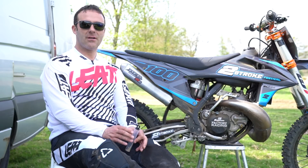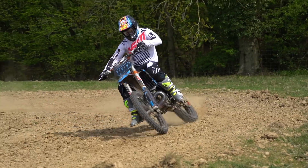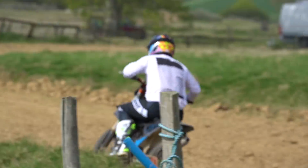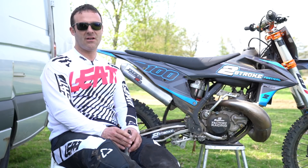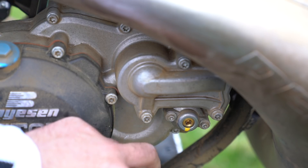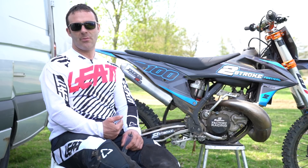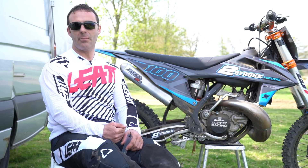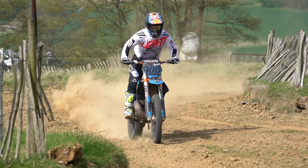For me, I really do like, on the setup that I'm running and the bike that I've got behind me on a 250, I prefer the standard spring, and I just wind it in just a little bit. Normally I'm roughly about one and a half turns, and that's from completely flush. The more that you wind in, the more load you're putting on the spring, so basically what's going to happen is that it's going to be harder for the power valve to open, so that hit's not going to be there — you're mellowing the bike out.